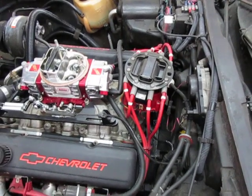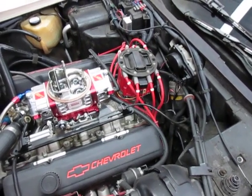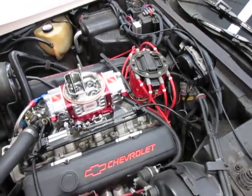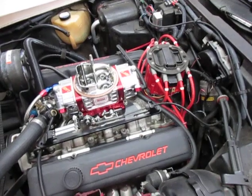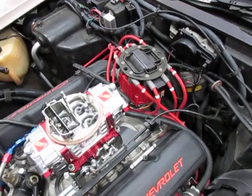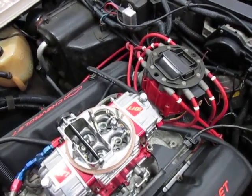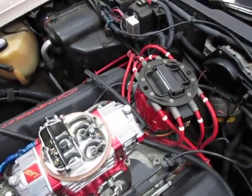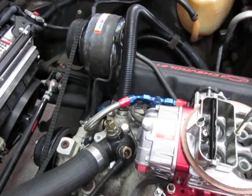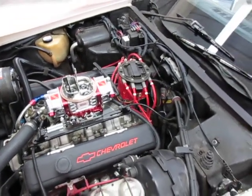This is a little video about the proper way to install an HEI distributor. Although these can be in any position to run — because with 90 degrees apart on every cylinder firing on V8s, it can literally be put in any direction as long as the ignition timing is correct — a nicer looking engine is when you have these things installed correctly, with the power wires coming in on the driver's side and the vacuum advance coming off on the passenger side, routing neatly over to your carburetor on your ported vacuum or manifold vacuum. Thanks for watching — hope this helps get some wiring and distributor installations straightened out.